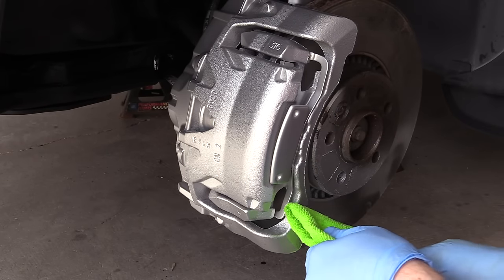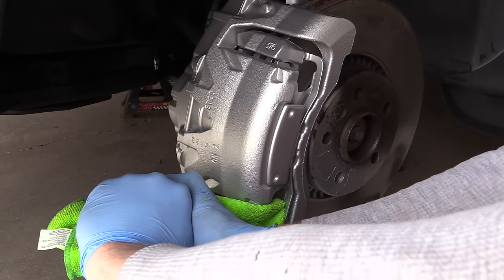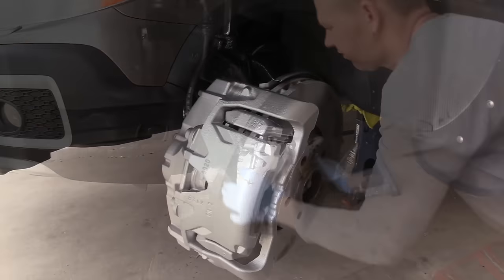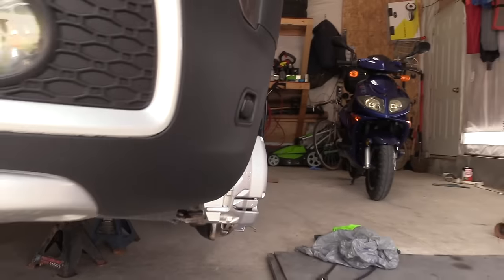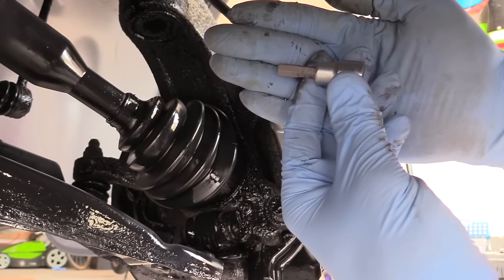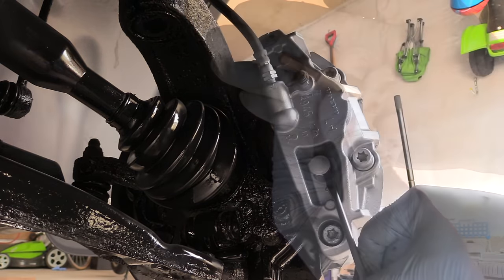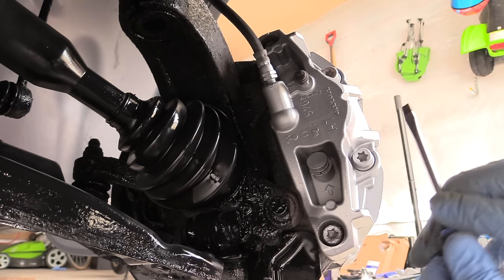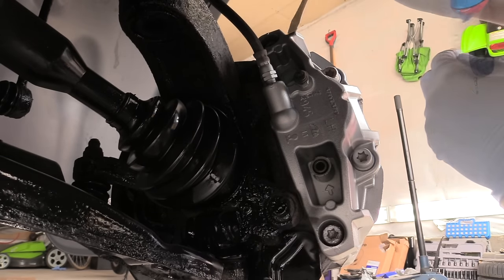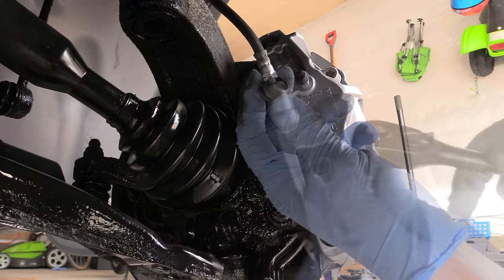If you haven't watched my other video where I did the rear brakes on my Volvo, I'll put the link in the description below. Now turn the wheels all the way left for easier access to the back of the caliper. You'll see a few torx bolts — don't touch those. You'll actually need a 7-millimeter hex. The locating pins are located under those protective cups — just use a flat head screwdriver to remove the caps, top and bottom, and then unscrew those locating pins.